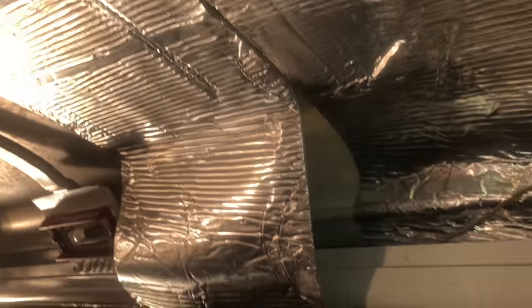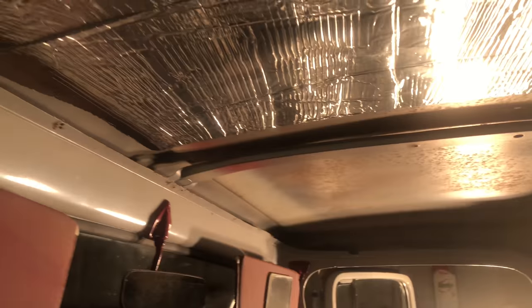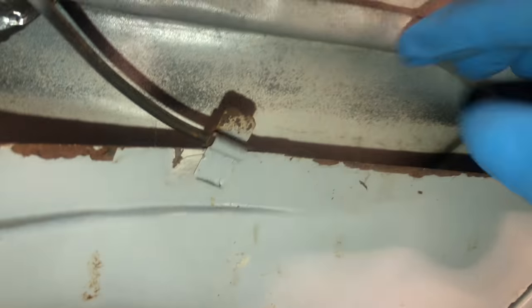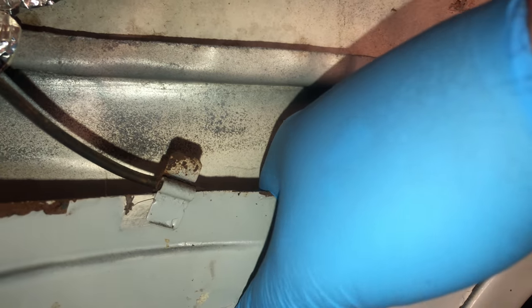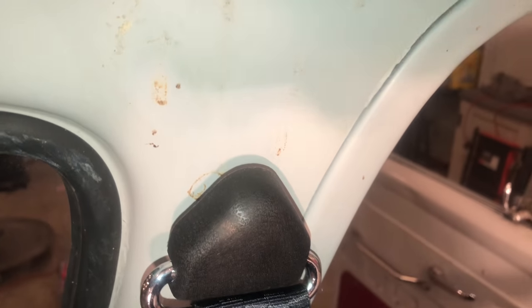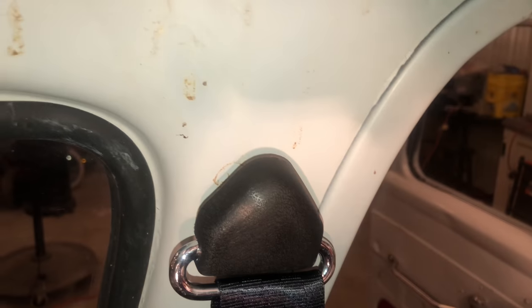Y'all will have to forgive me — I've sort of gotten ahead of myself a couple times here lately. I'm going in right now and putting insulation and sound deadener in. This is self-adhesive. I've only done a couple of strips so far, but it's been really easy. I'm getting ready to put my headliner in. Since we last spoke, I also went in and put in a three-point harness. A little tip for putting in a three-point harness in a vehicle that never had one — I used a zip tie to hold the back plate that I bolted in.